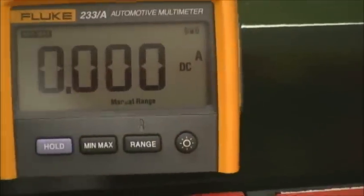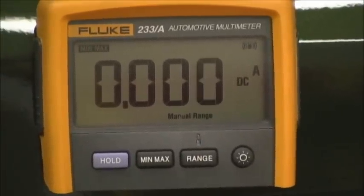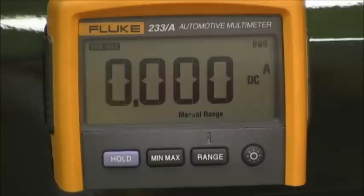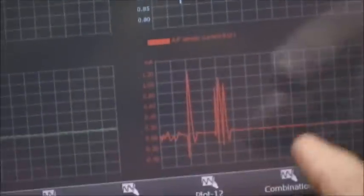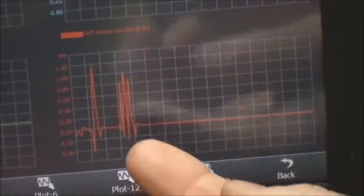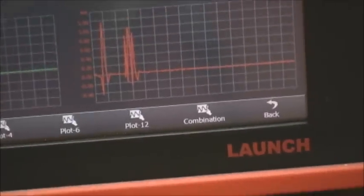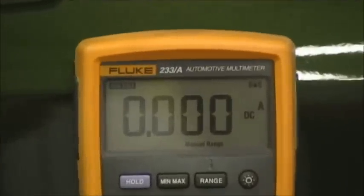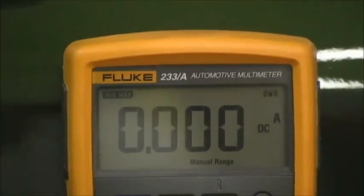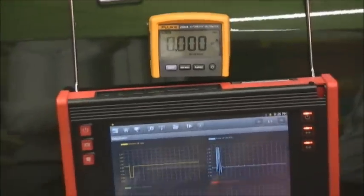What we're showing you here is when you use a digital voltmeter in series measuring amperage, we open the circuit up. You can tell the scan tool is doing a great job. If we go back down to scan data — amperage is the red one, sensor current — look at that, it's straight down the center, the average of zero. So this is a quick way. There's our Launch scan tool and our Fluke meter — these are two of the tools that we picked. And notice how that flickered from a negative number — this is fuel control off an air-fuel ratio sensor.